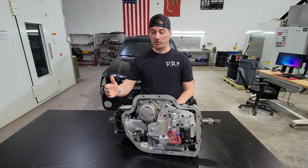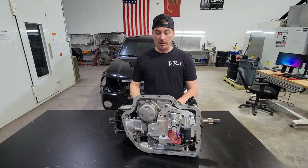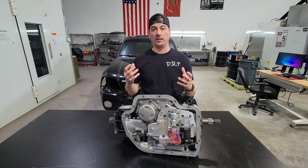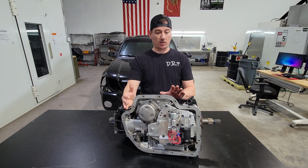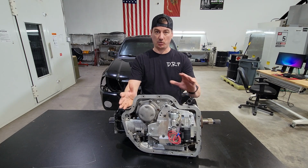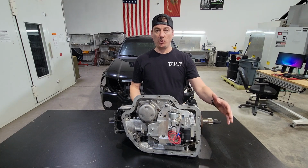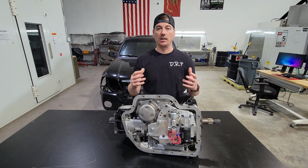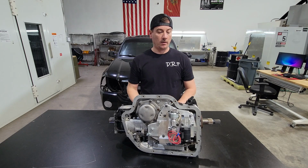All right, you need to get fluid to your rear case bushing and to your tail shaft bushing there for your drive shaft. When you're using the external dump valve, okay, so we'll talk about what they're doing in a turbo car. What they want to do is they want to create this hydraulic leak from the exhausting side of the cooler circuit here to the cooler, okay, creating a hydraulic leak, allowing fluid to not be held in the converter, okay, basically giving you a looser converter, right? So a looser stall converter.